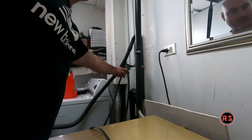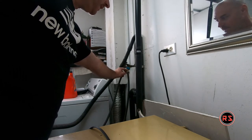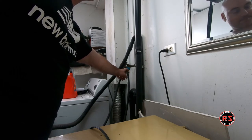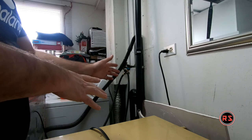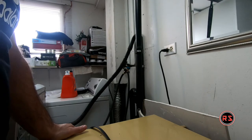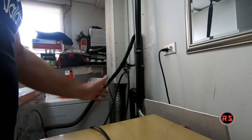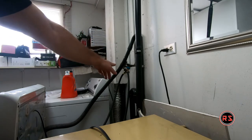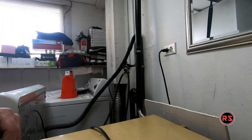There's a little O-ring or a rubber washer in it, which is sitting between the seat of the hose and the valve itself. So as soon as the rubber is tight on the valve, there's nowhere that the water can leak. So I often see complaints from people saying there was a leak because the installer only tied it by hand. It was not the fault of the installer on this one, because it doesn't need to be tied by anything else than your hand. You don't need a tool to tie that.